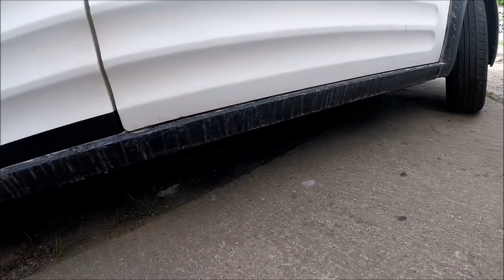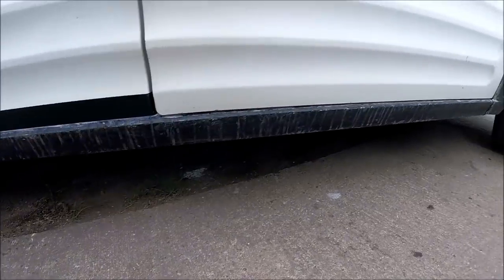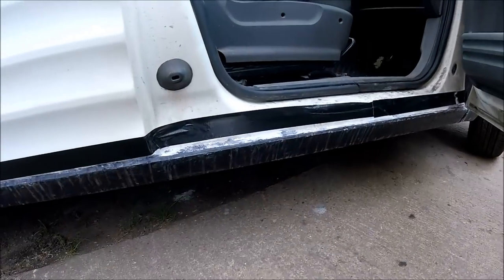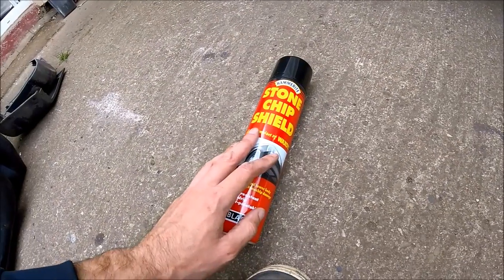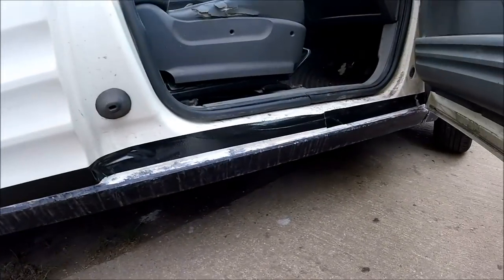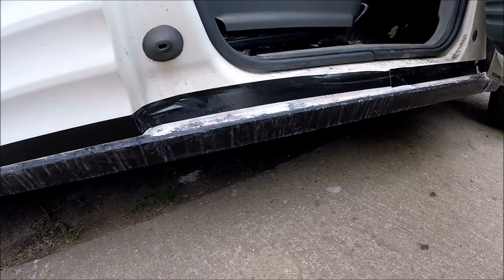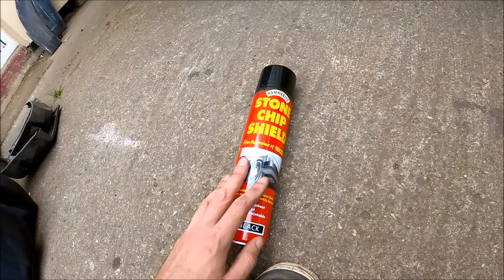Now all the Hammerite Kurust has had a good chance to dry up. I've just given it a quick wipe down and masked off the area all the way along and inside as well. Now I'm going to give it good protection with some stone chip — apply that first — and then the whole van is going to be going in for a full paint job as well. Once the paint's been applied over the stone chip, the sills should be fully protected for many more years to come. I'll get some of this applied and you'll see the fully finished painted sills when the van goes in for paint.